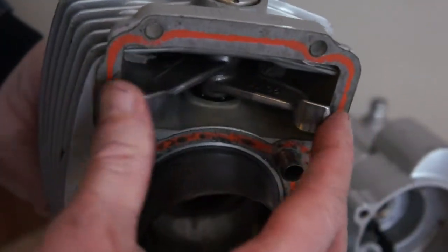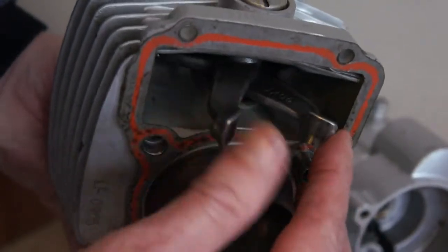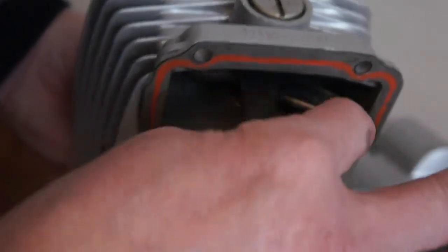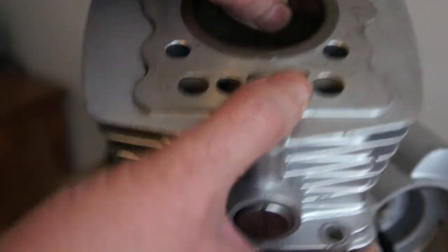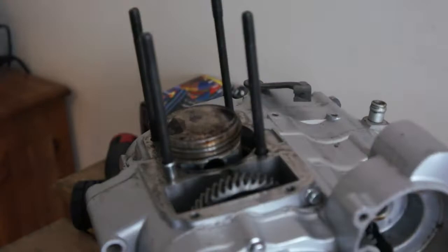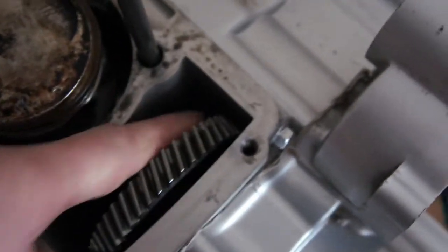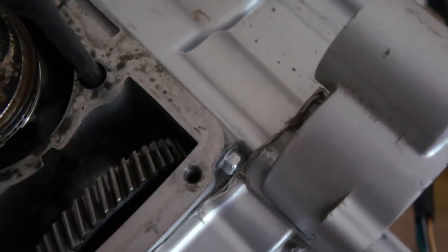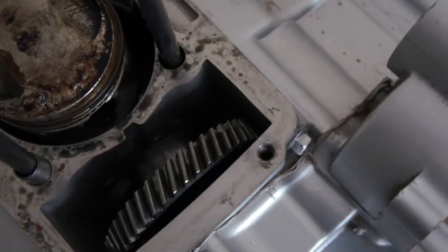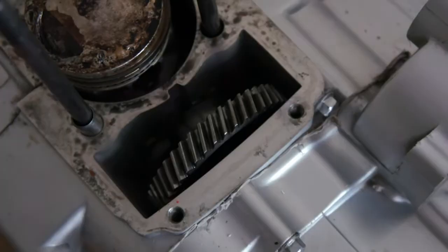There's your followers. They move up and down when the camshaft turns, lifting your pushrods and opening your valves. Your cam is there, the lobe sticking out that way at the minute. So when it comes to the top, it'll lift either your exhaust or your inlet valves. Pretty simple really.